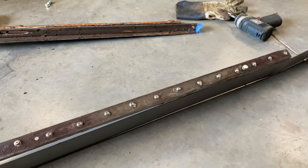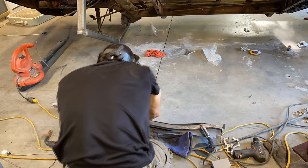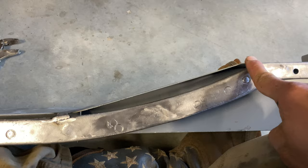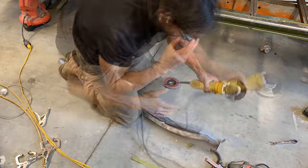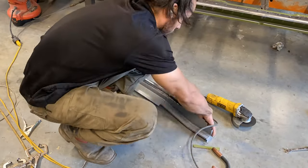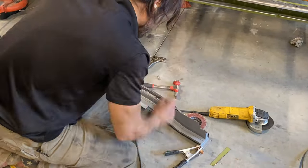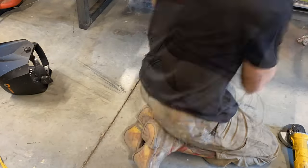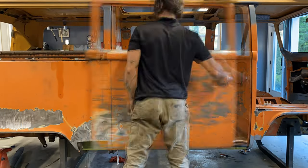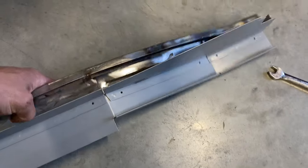I am using the Just Camper's middle rail, and there are a few things about it that you're going to have to modify if you use this piece. One of those things was this curve here. It didn't seem so important at first, as the top wheel was rolling in the top rail and the bottom one would slide perfectly on the middle rail. But the problem I found after testing it multiple times is that if that back part doesn't curve close to the top rail, the top runner could slide in and out. So my solution was to cut it, bend it — I only had to do about one inch of the back part bent in — and this seemed to solve the problem perfectly.